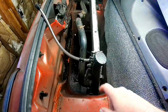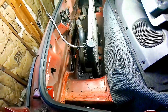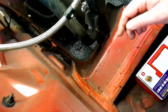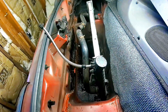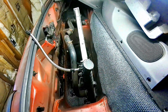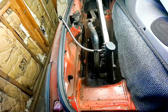The next thing we're going to do is cut the bottom out of this T-top well so the radiator will drop down some more. I'd really like to get it flat across here — I measured it and we've got to drop the radiator close to four inches. We can do that with a combination of tilting it back more and dropping it down. I'm hoping to keep the center exit exhaust since I still want some street function to the car, at least for now.